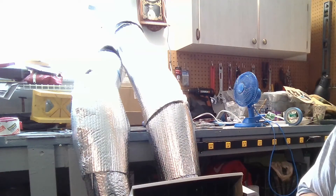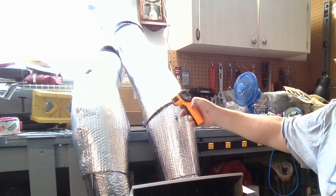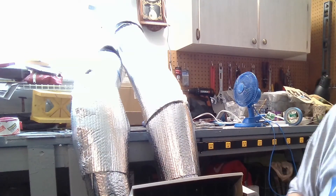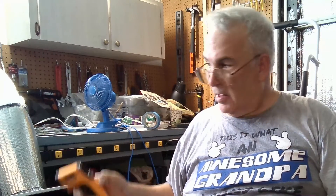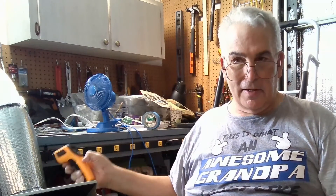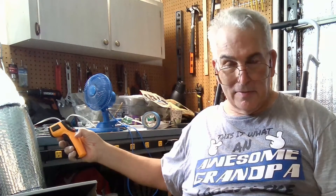I'll eventually go back in and finish sealing all those joints with duct tape. But the bottom line is this is going to save me on air conditioning electricity and make my portable air conditioner more efficient — because the hoses are no longer causing heat transfer back into the room. Insulating the intake and exhaust hoses reduces my overall electric bill and increases AC efficiency, since the unit doesn't have to fight against the heat radiating off the hoses.